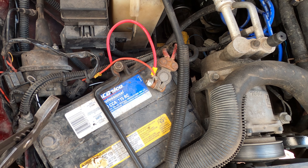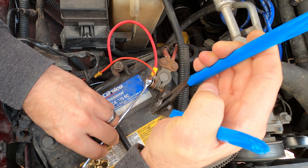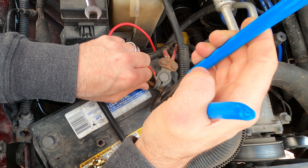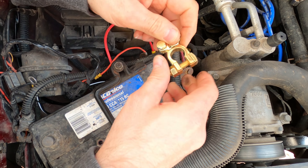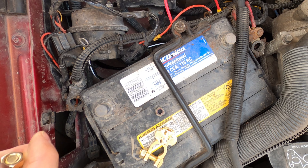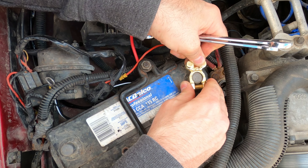The positive is going to be a little more of a hassle — I'm going to have to use pliers to hold down the side of the battery. This was a temporary setup just to test the air compressor. No time like the present to improve something you did temporarily, and at the same time I'll be able to remove the wiring for the auxiliary lights. Double checking with the other post — it is a little snug, so the positive is a tad bigger on this battery. I'll have to open this up just a bit. What I've done in the past is put a few wrenches and push against each other just to get it to open up a little, squeezing it to bend it up — don't need a lot of extra room, just enough so it slides into place a little bit better.